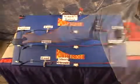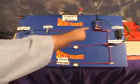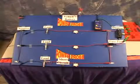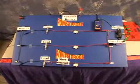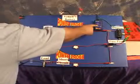Here it is. Now let's go ahead and plug in the end of the wire. Now suddenly we're receiving a tone from the smart transmitter. This tells us that our circuit has now made contact with ground. To toggle the tone off, just press the tone on-off button.